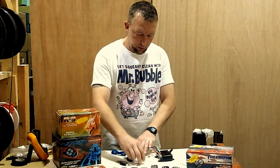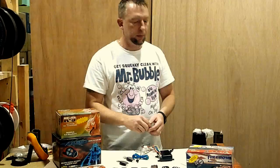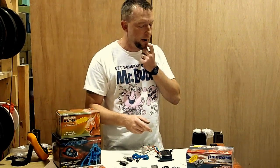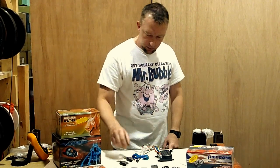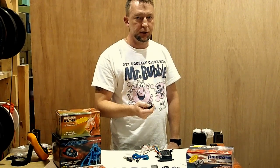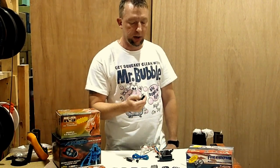Since I'm not doing this in a car itself with the alarm system installed, I'm just going to turn the ignition on because you do need to cycle your ignition in order to program a transmitter. So I'm going to make sure my system is disarmed - that's the first thing you need to do, make sure your alarm is in a disarmed state before you attempt to program your transmitter.